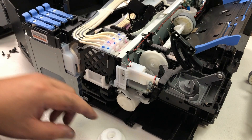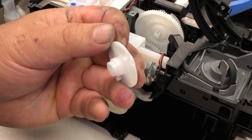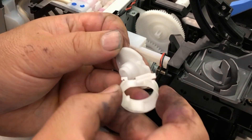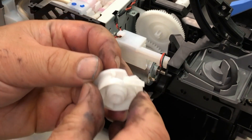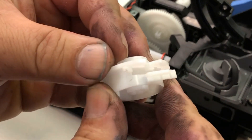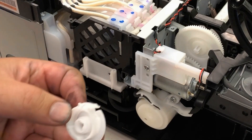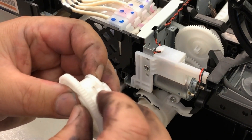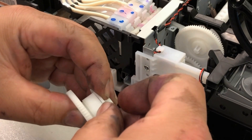Just in case you mess up the holder clutch, you have a four-piece set. The first piece you hold like this, then add a second piece with this long arm facing forward. You can see there are two small hooks — that'll be the place for the spring. Now add the really big piece and then you just need to install the spring.